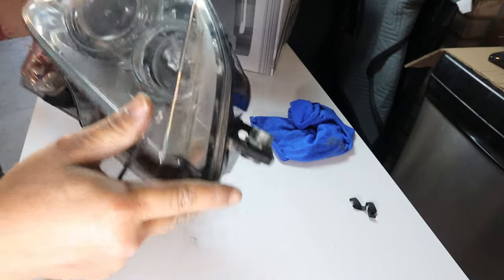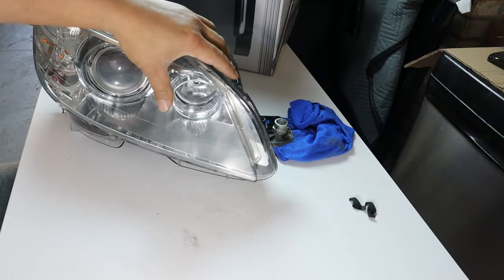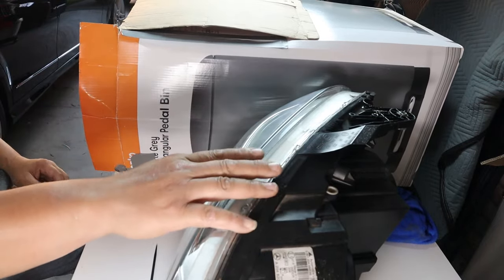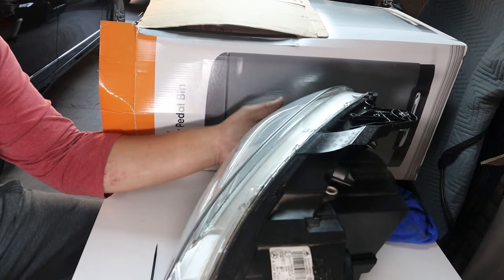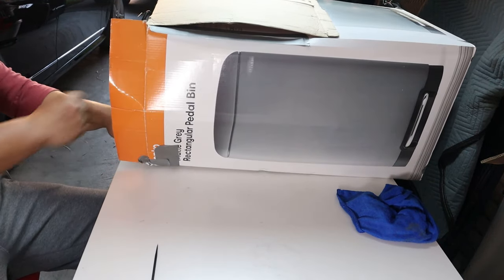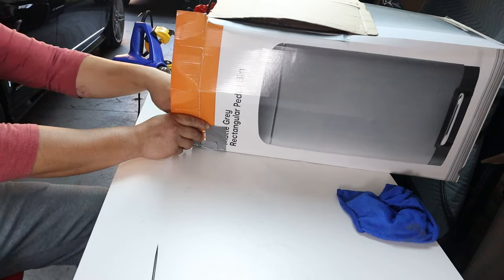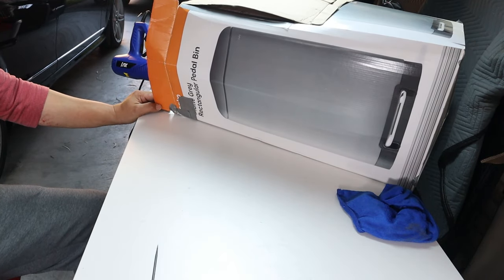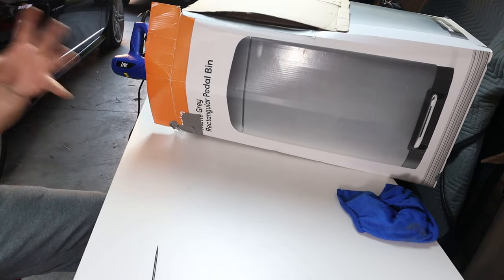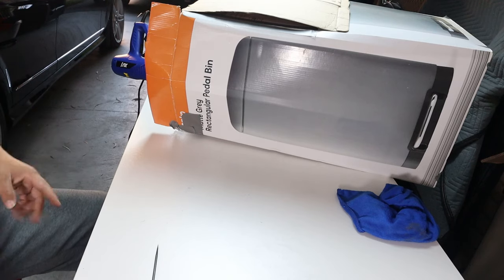That's four clips removed. I leave my ballast in place because it sits on the ground and is the only thing holding the headlight up to bake it. I have a big enough box to house the headlight, and leaving the ballast on means I can sit it inside resting on top of the ballast. I point my heat gun inside the box, trying not to point it directly at the headlight. After about 10-15 minutes you should be able to pry it apart — I'll show you when we get back.